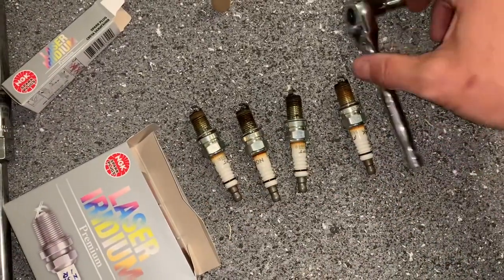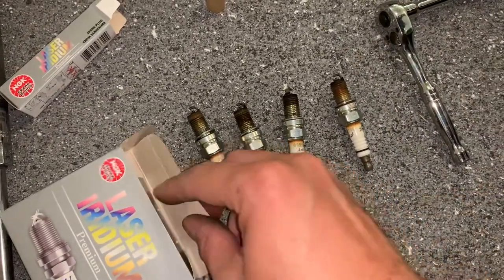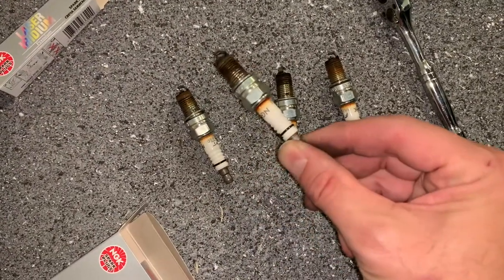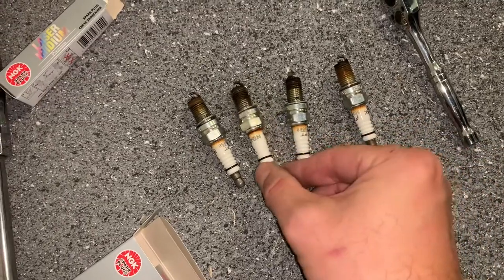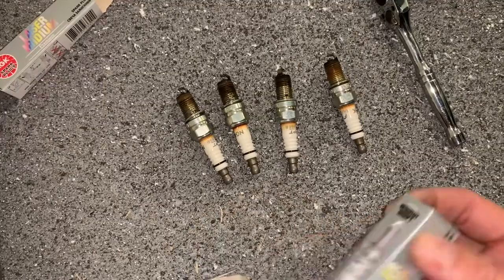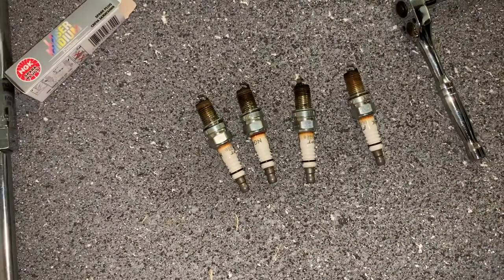If it's a car that needs new plugs every 30,000 Ks, it's going to go through plugs. And it's something that if you skip, I think you're going to pay with very poor ignition and probably bad fuel economy. We haven't had the car long, but we'll change all these over and it should be running much nicer.